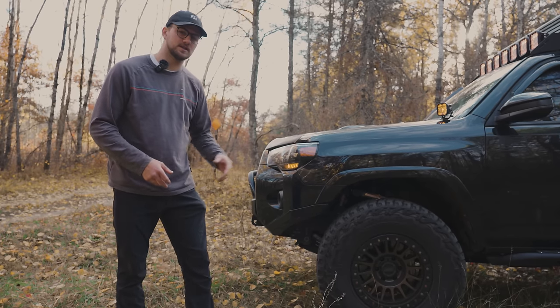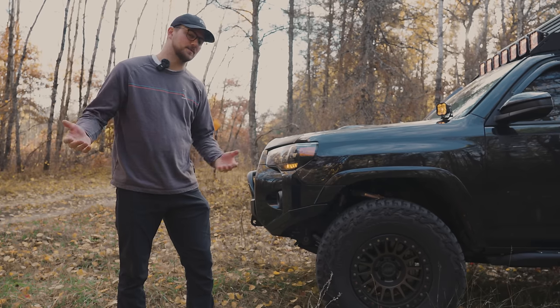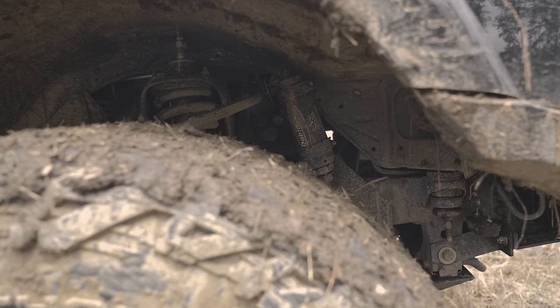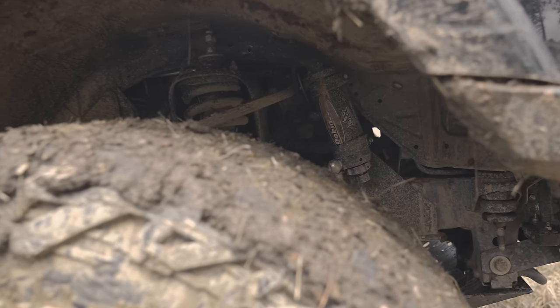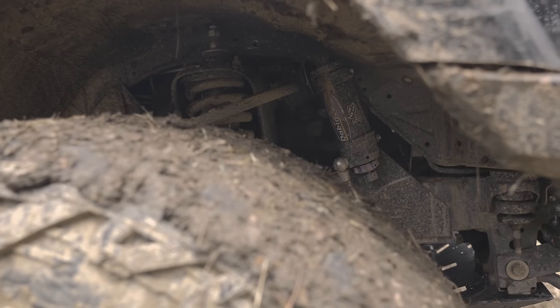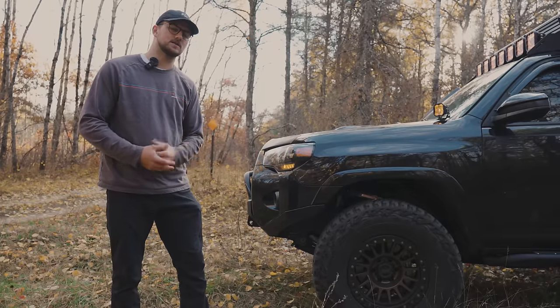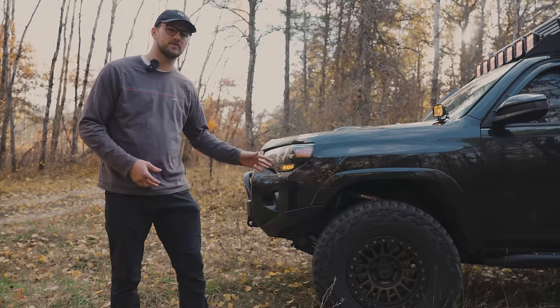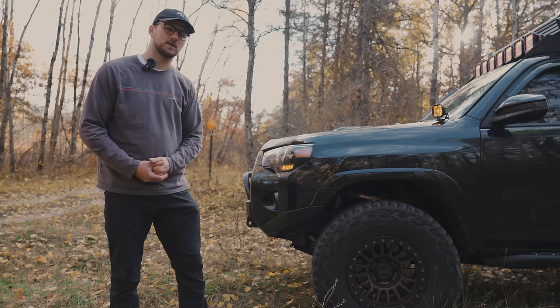As for the suspension, it's a 3.5 inch Dobinson MRR lift from Dobinson. Nothing overly fancy, just their Dobinson MRR lift. I've got aftermarket upper control arms from Dobinson as well. It's their billet upper control arms. They have camber adjustment and a little bit of caster adjustment in them, and they're perfect, super easy, and they have a sealed ball joint, so they're super low maintenance.